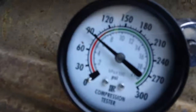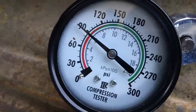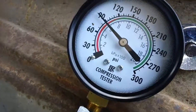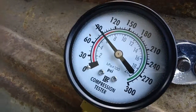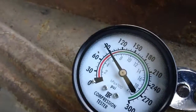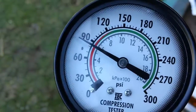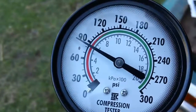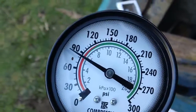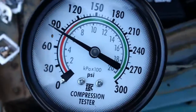Okay, here's what I've got - about 90, right on about 90 on the first cylinder checked. It's not very good, but it's a 52-year-old motor. The last one is a little under 90. I was thinking this thing's cold - I haven't got it running yet - and you're really supposed to check compression when it's hot. I wasn't really thinking about that to begin with.